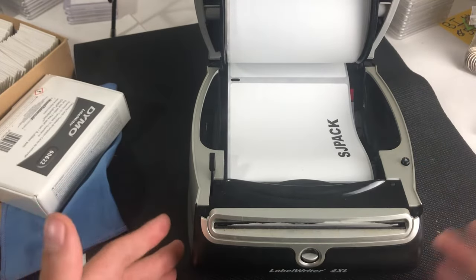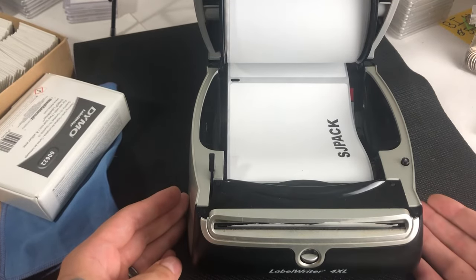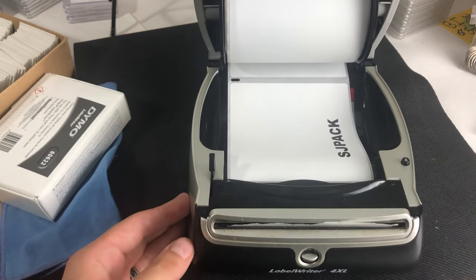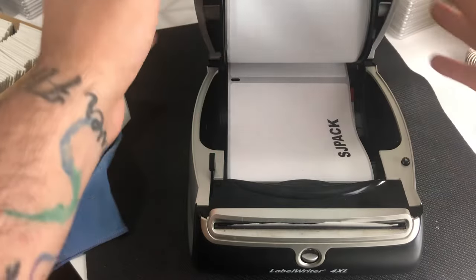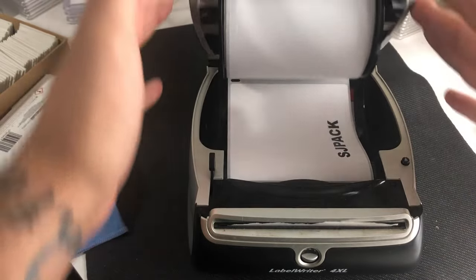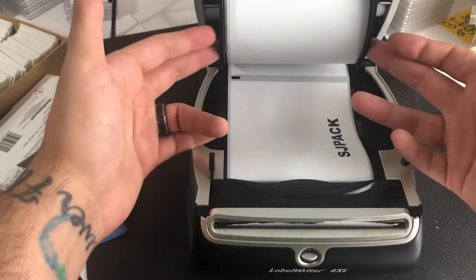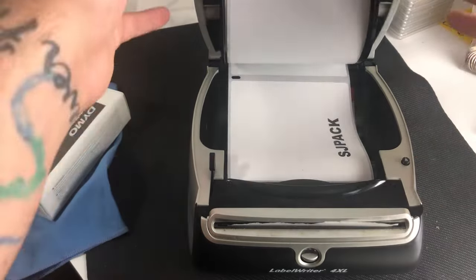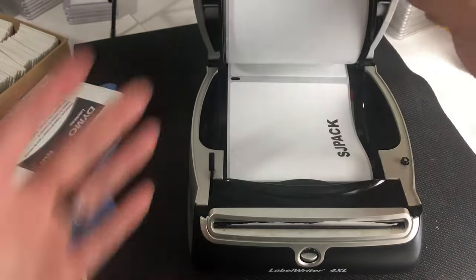You want to make sure your label orientation is perfect. This is a picky machine but it's super easy to run — we've run over 2,000 labels through it and only had to troubleshoot it maybe three or four times. The machine will not print if it's open, so it does have to be shut. If you have a label that's too big — some UPS labels are way too big for the DYMO — it's not going to close all the way and you'll get a gap, and it won't print.